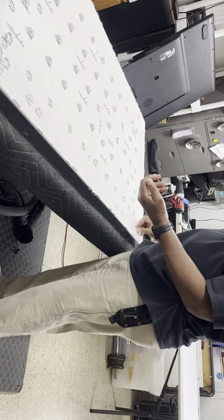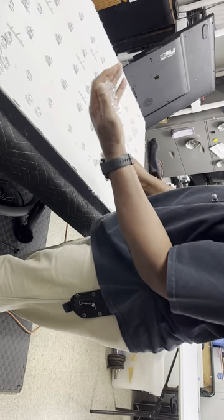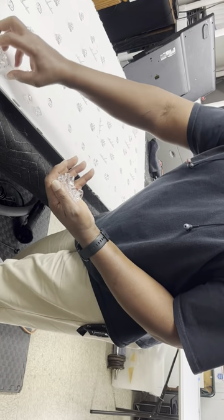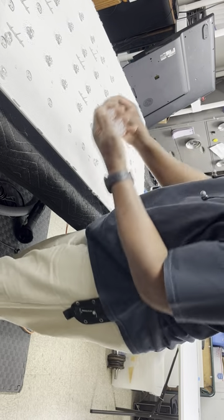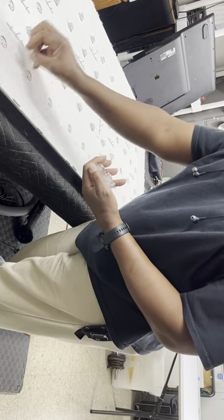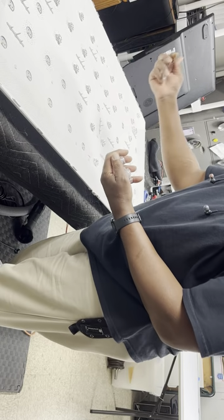Look at that. Look at all the lenses. So even if your TV does come on and you see circles in the picture, you know that the lenses have fell off. So you gotta replace the LEDs. They pretty much just come off. Look at that, see that? I just left them right off.